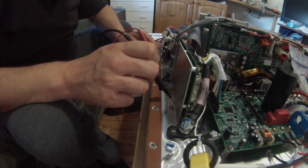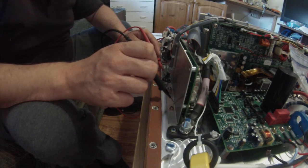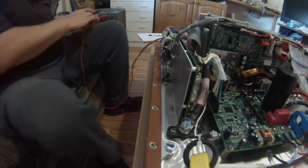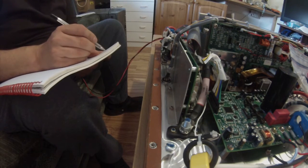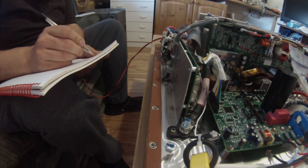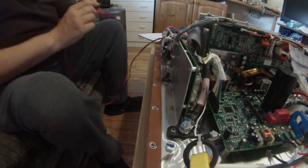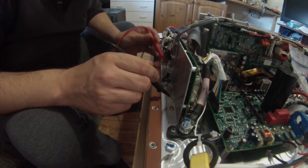I'm going to have a look around some of these pins and see if any of them — okay, there's one — it is an absolute short to ground, which is perfect. So the white wire is a ground, and I can note that. White is ground.